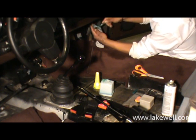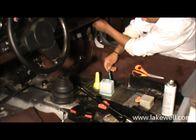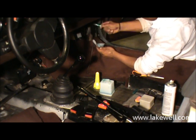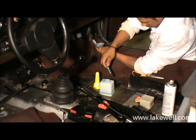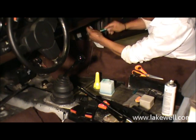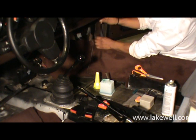As you notice, this is a different type of glue. This is a polyurethane glue, but a neoprene based contact glue would also work. The reason we're using this glue rather than the other type is because this is a small surface that we can glue on. We want a strong bond, and for those characteristics this glue simply works better. So he's applying it double-sided, not only on the flap and on the A-post side, but also in the weather strip gutter, because this flap will glue onto the side and then into the gutter.